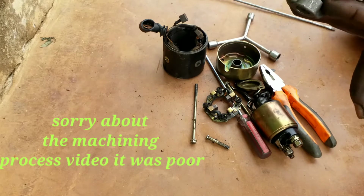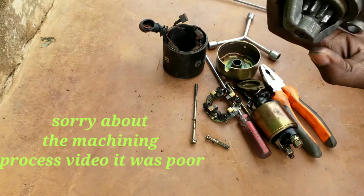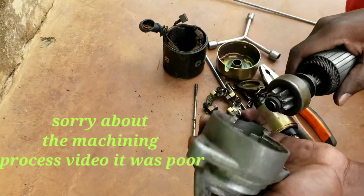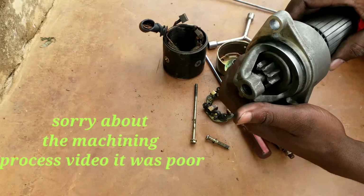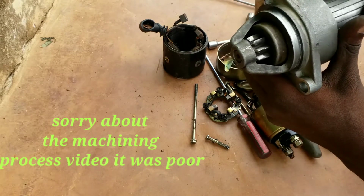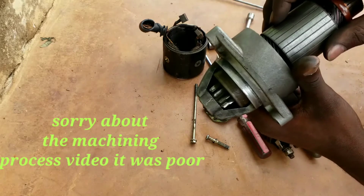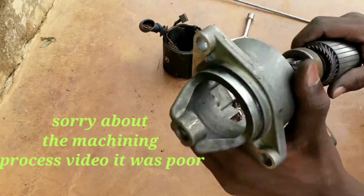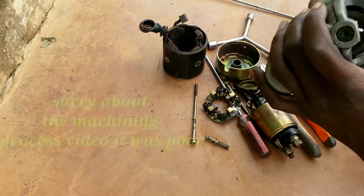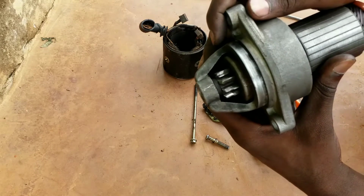This washer plate here is a gauge so that this plunger does not hit direct to the housing, because it is quite easy for this plunger to hit the housing. Just if I remove it and fix it direct here, you see that mess? So they tried to eliminate that mess, this plunger meeting direct to the housing, because it can eat it up. It hits strong, heavily, to rotate. But when you place this in between here and fit it in like so, the plunger does not reach the housing.